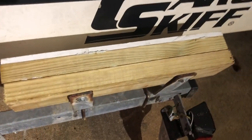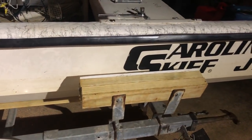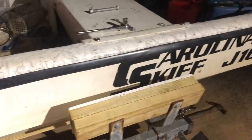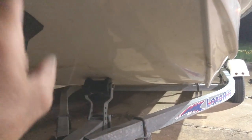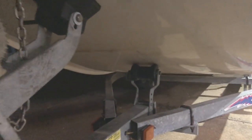Isn't that awesome right there? That should be no problem at all for that boat to hit that edge. The boat kind of slowly comes up, curves in at the front — it's not a square bow — so it's going to slowly come in. This will guide it right into the trailer and put it right on top of the proper position on the trailer. So we don't have to worry about it, and it'll be very efficient and fast loading. We're going to put one more on the other side just like that. And you see here, the bow will hit this bumper right here — I got a new bolt to put in there and it'll hit that roller right there. That'll keep the boat from bouncing up and down going down the road. When I push it up on the trailer, it'll hit that right there and stop real quick. I'm going to pull everything up about six inches so everything should ride perfect.